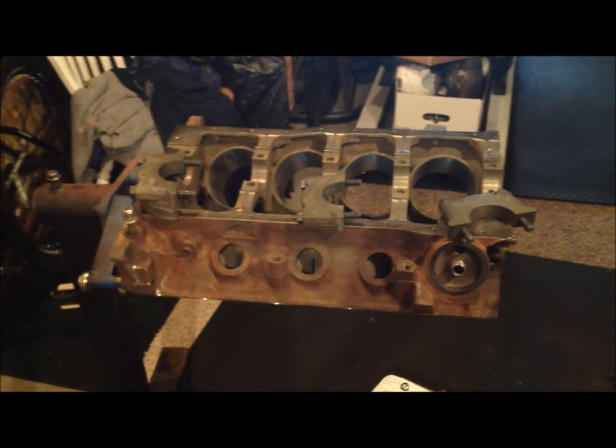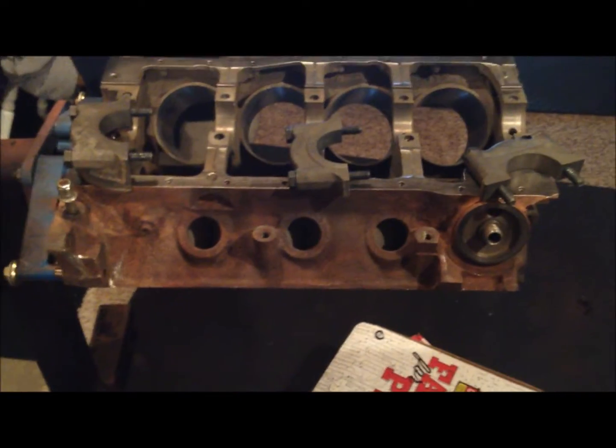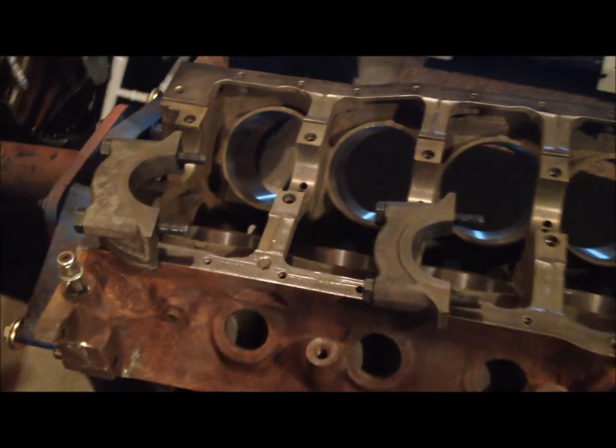How I do this is I'll use a few old crank bearings and rod bearings. You should only need one piston and rod assembly, and you want to have your new pistons already pressed in. You want your block already sent to the machine shop — mine was already rough-bored 30-over — so I knew to buy 30-over pistons. You want to use the actual pistons going in your engine because every piston is different.